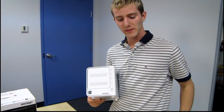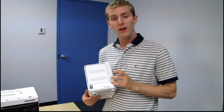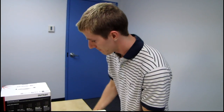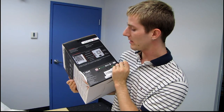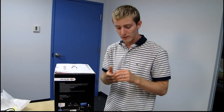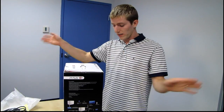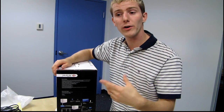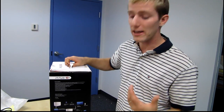RTM — read the manual. The button on the front is actually a one-touch backup button, which triggers a software event to run a pre-configured backup. Patriot recommends using enterprise or RAID-edition class hard drives for maximum reliability with RAID 0 or RAID 5. With RAID 0, you lose one drive out of four and all data is gone, so just don't use it. With RAID 5, the array is vulnerable during a rebuild — if another drive fails while rebuilding, everything is lost — so enterprise class drives are best.